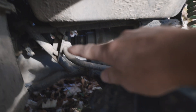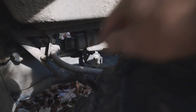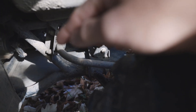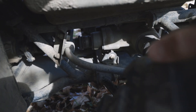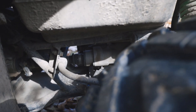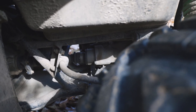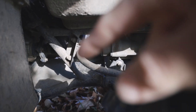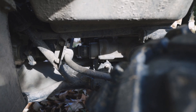Another thing is if you have a sway bar on your ATV — at these mounting points, same as with the suspension bushings, you'll get dirt in there, go through water, and sand or dirt will cause squeaking in the plastic or rubber mounting bushing. The trick for that is to take it out, clean it up, and put some grease in there. Or you can totally remove your sway bar if you want more articulation or better crawling — but if you're towing two passengers or trailers, you'll probably want to leave it on.